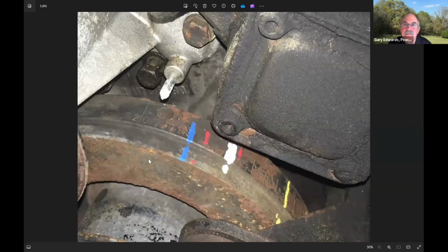So when I lined up the right side cam, this is what I found down at crank. And this is about 16 degrees after top dead center. And you refer to that as chain stretch, even though it's not all chain stretch generally, but that's really a problem. More than about 9 degrees or so is really a problem. And in fact, if you're off one tooth on the cam, it's 18 degrees out down on the crank. And so this was almost a tooth off. It makes you think maybe it actually had jumped time at some time.